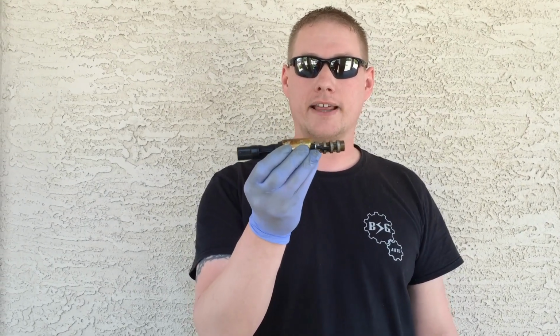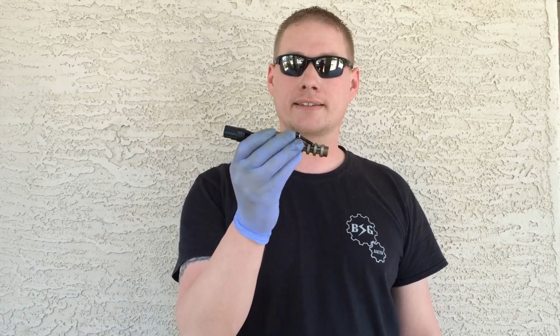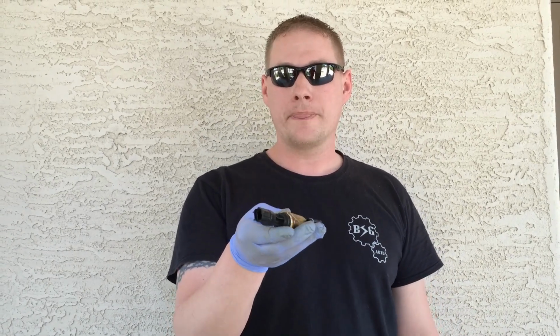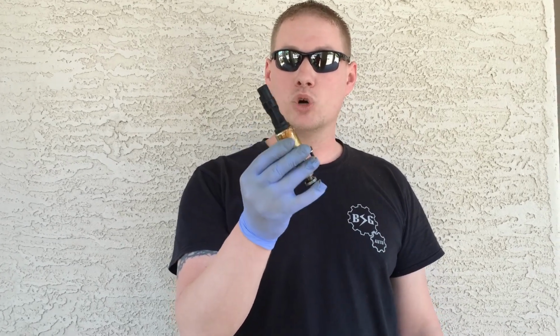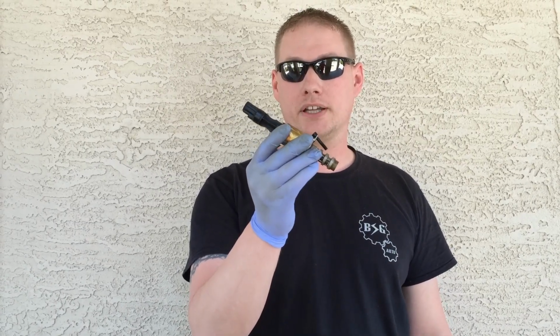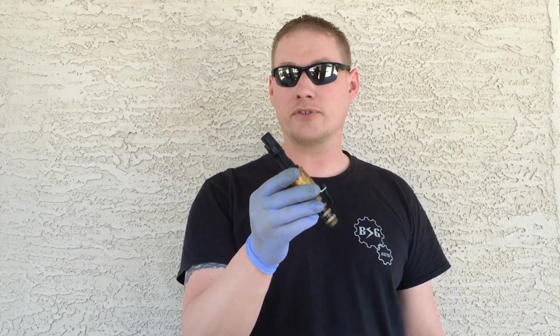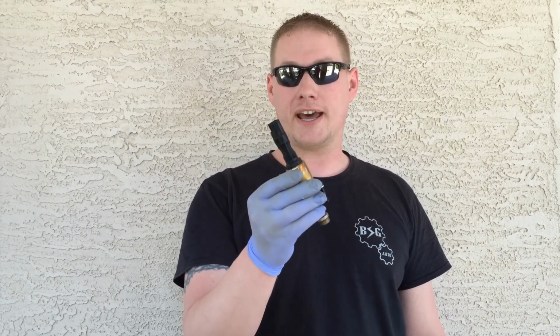The spring inside of here that puts it back to that position and holds that valve in place can actually give way because it's so weak from all the heat cycles over the years. So today we're going to go for a drive, and show you this solenoid in the vehicle and how it's still moving even though it's disconnected, and what the PCM's seeing and what's actually going on. And then we're going to take this valve apart, show you exactly why it's happening, and then we're going to go for another drive with a brand new VCT solenoid in the truck, and I'll show you how it should react.